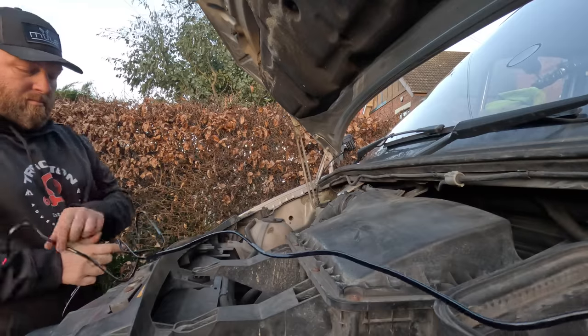And then, as you can see here, they've given you a switch cable, so that can go on your dashboard somewhere. Rather than having the switch cable go to the dashboard, there's multiple options. Some people wire this direct to their flashers on their high beams, so when they flick the high beams, it flicks on. What we're going to do is wire that one back to our switch panel, so that goes under the seat into the switch panel, and we can control it from the little switch above, which keeps everything together, keeps everything fresh, doesn't it? But like I say, if you don't want to buy the panel, it's a self-contained kit.